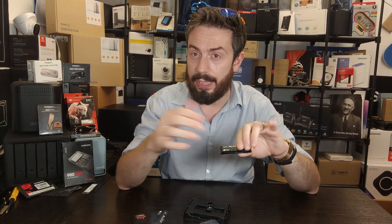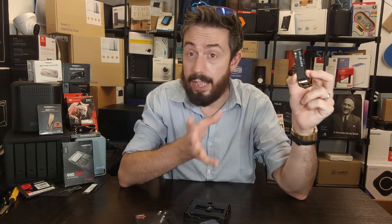Getting a drive with both the heatsink and drive together eliminates any warranty concerns. Very few brands will ever say they won't honor a warranty because you didn't use their heatsink — but with a contained unit, there's no debate. There's no question about which heatsink you're using or the environment you're using it in. If you get an SSD with their heatsink, that's the end of the conversation.